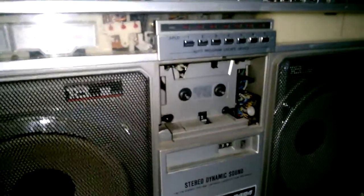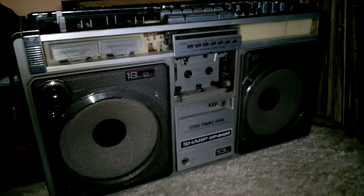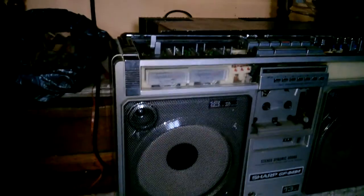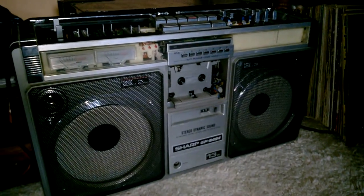And also something on this, it's a Sharp G9494. I've ordered new belts and I've fitted them, and I now find that it needs a new capstan pinch roller, a tiny little bit of rubber. I think it's the best part of £20. I've ordered it already, so that's to come.